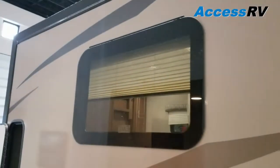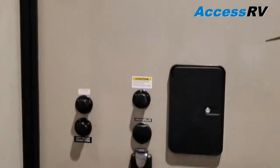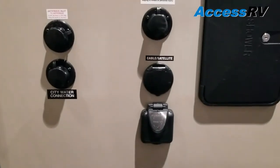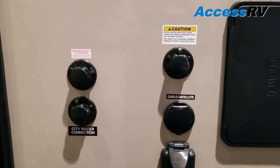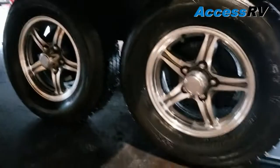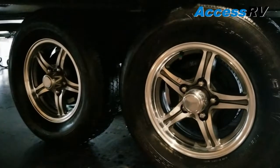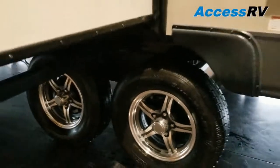Tinted frameless bonded windows. Your water and power connections are back here — detachable 30-amp marine shore power cord, city water, quick antifreeze inlet, and your black tank flush directly forward of your utility shower. The Microlites come with some really nice aluminum wheels and utilize torsion axles made by Dexter to give you a really smooth ride and a longer warranty period than your traditional leaf springs.